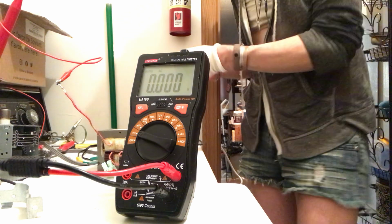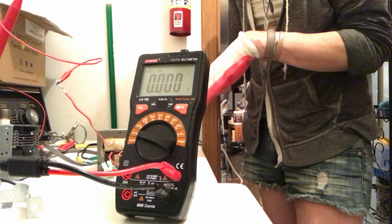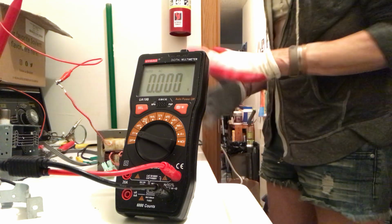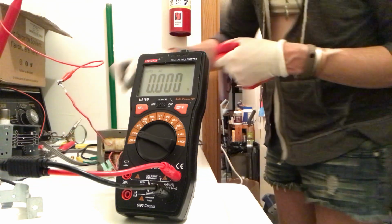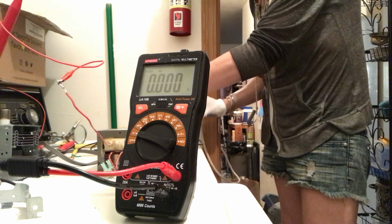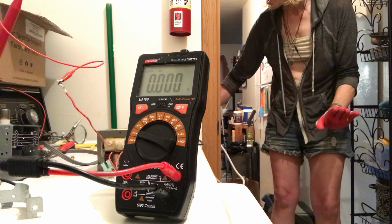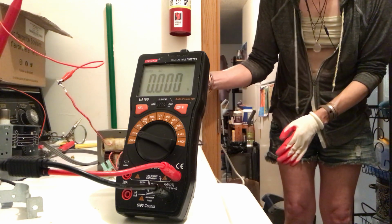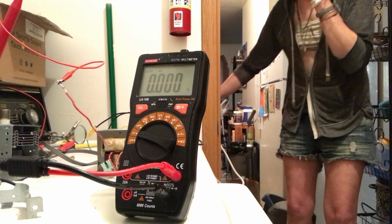So we got the line voltage going onto the primary with alligator clips. Not the best thing, but we are far away, and it probably shouldn't be done on a metal surface. These are the heater cords, they're tucked away. That is the high voltage, so the high voltage is going there. That's lethal. So this is off, this is on. I'm going to double turn it off. Okay, so that bar outlet's off. This one's off, and then we'll put it on, and then turn this one on, and now we'll turn this one on.